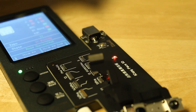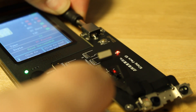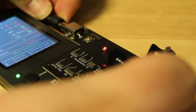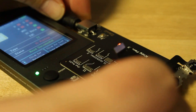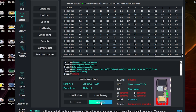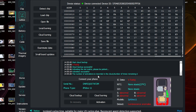For the next step, we do need to connect the power supply. Now we just need to activate the dot projector — we click activation. What's actually happening here is the power supply is physically fusing the component. You can see it says 'activating the dot matrix, please be patient.' It's physically fusing the MOSFET inside the dot projector. Activation successful.